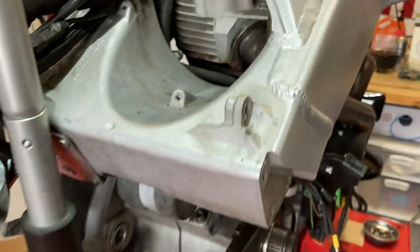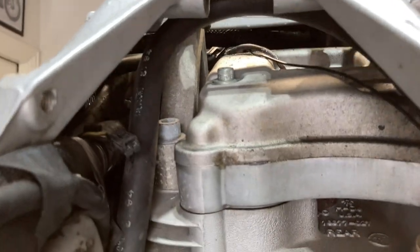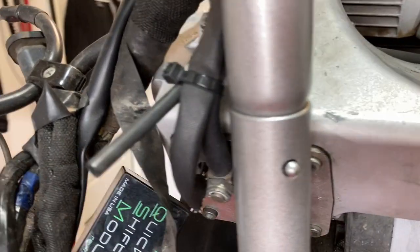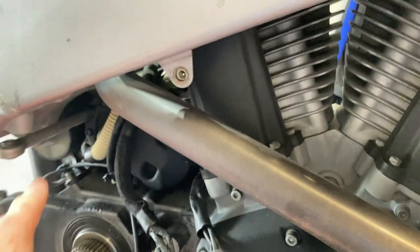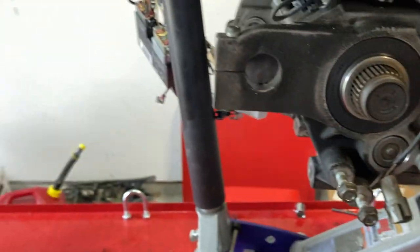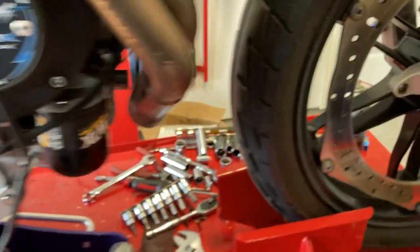What I have to do now — you can see I've got everything out of the way for the harness, so dropping the engine should be a little easier. That should all come out as one unit. I still have to take the fuel pump and all that stuff loose, fuel lines, etc., which also means I have to replace all those O-rings. The rear and front isolators are still connected, so the engine is still in there. I put the jack in here just to hold this guy up. I might jerry-rig something with my rear wheel stand.